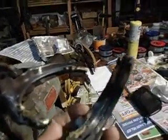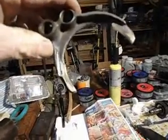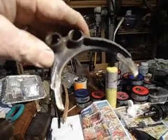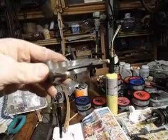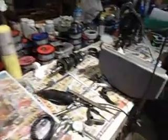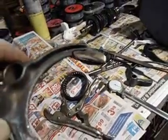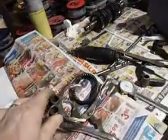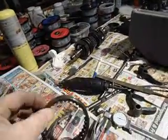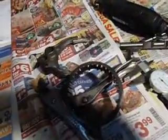Shift forks — there are two styles that wear out. The one on the right controls first and second, or third and fourth gear. I just brazed just the one side of this, and then filed it very carefully, checking it quite often with the calipers. Got them set to the thickness they were supposed to be. I got it so it's almost dead on when you slide the calipers. I stuck it in the slider and it fits in there. It moves about the same top and bottom, so I'm going to go ahead and use it.